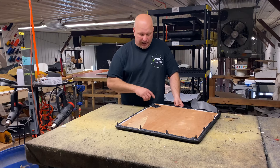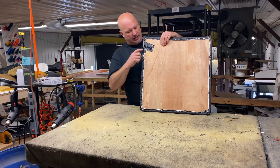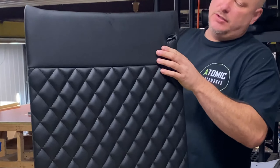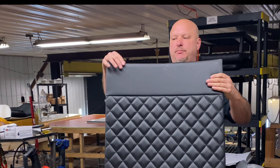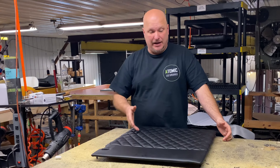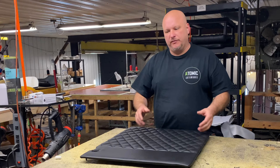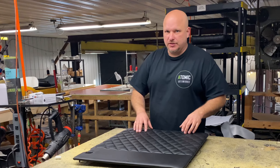I just went and made my adjustments for the door panel. I wanted to put a little flap there so now the panel can actually come through, and when the door handle comes through you don't see the black backing from it. I brought the top of the panel up a little bit in a couple areas just to meet the body a little better. Now we're going to go to our final test fit. A lot of upholstery is fitting and adjusting and making sure everything's perfect, because everything has to be perfect before you put it on and your gaps have to be really crisp.